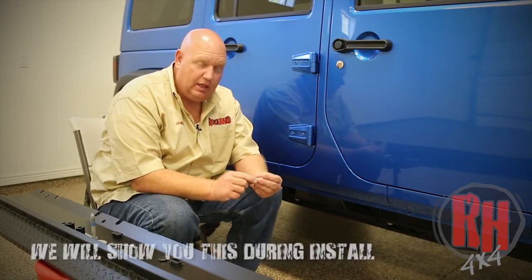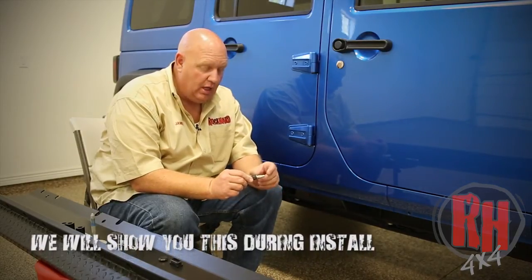And you're going to tighten it down, and then you're going to use an Allen wrench here and a 9/16 inch wrench here. What nut inserts do is they pull as you thread it, and it's going to tighten down on the body itself here.